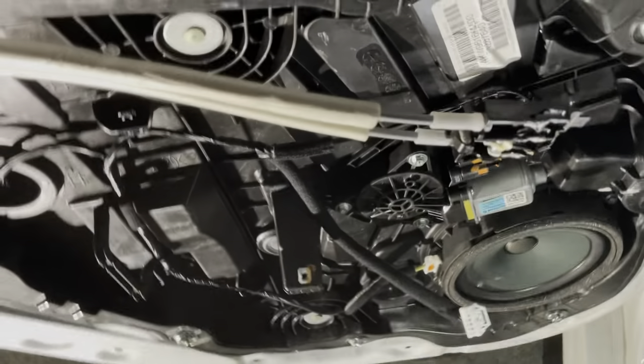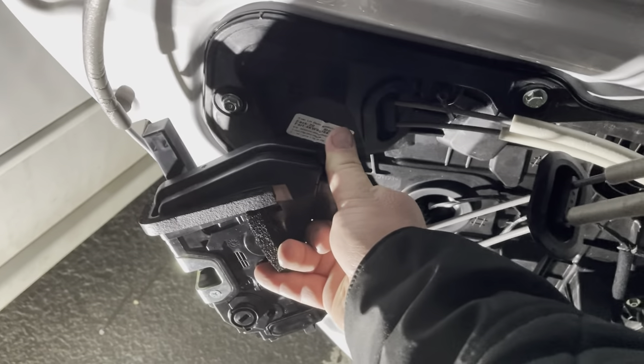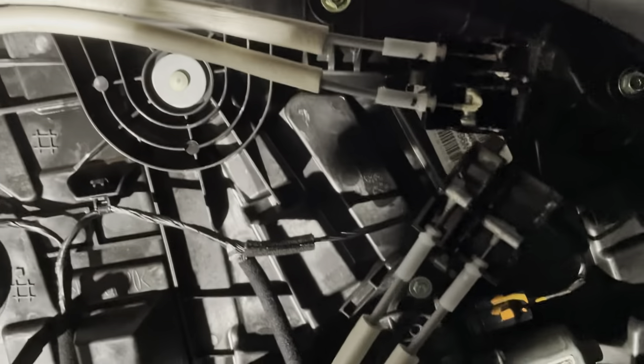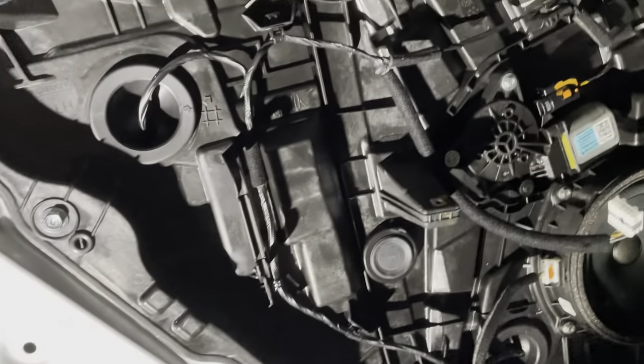So I know it's the mechanism inside. There's going to be a screw behind here and one in the cup holder — sorry, where you put your hand to close the door. I'll get to that point. This is the piece I grabbed — this is what I'm replacing. It fits inside like so, and you can see the old piece and the new piece right there. Looks like I've got to pull this panel off. These are probably just 10 millimeters so I'm going to pull those off.